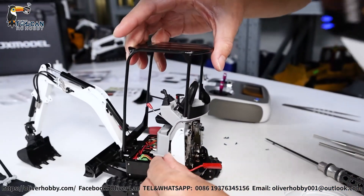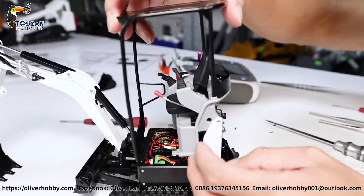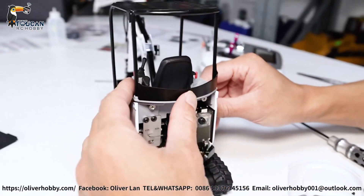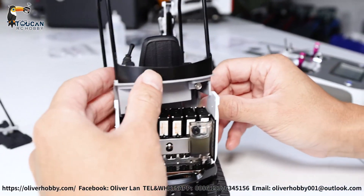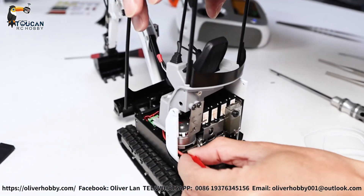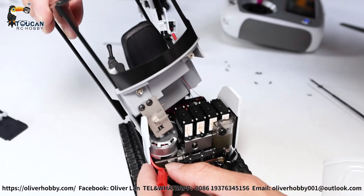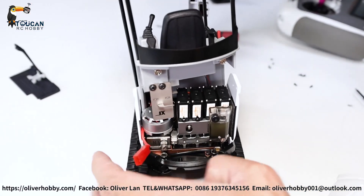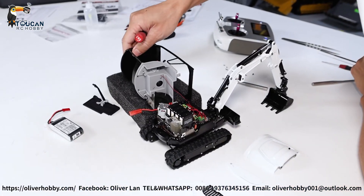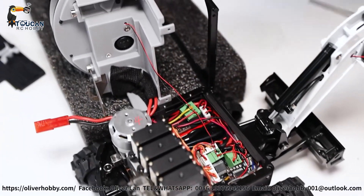So be careful not to touching, pulling the wires. Here have one small wire — let me see it, not to pull it. That's a wire, actually it's a long wire. It's okay. Only this power wire needs to be careful. So I only half-lift to show you. Pulling this one — that's the power wire here. So when you're lifting, be careful because here have two small wires. That's for the speaker.